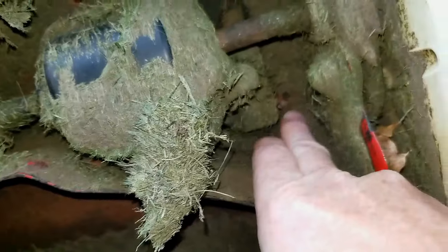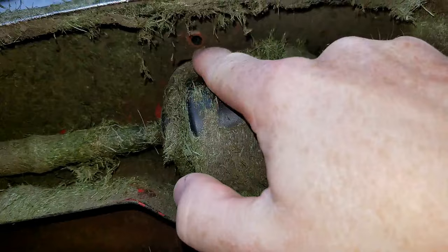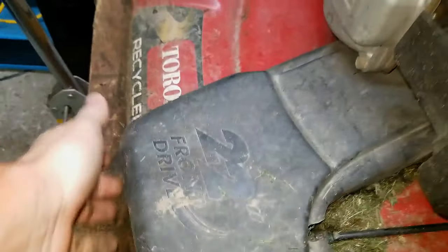I'm not sure we're going to be able to see that, especially with how dark it is here, so I think what we're going to have to do is take off the top cover to get a better look at the pulley on the front end on the transmission side. I've got the mower tilted up and there are two 10 millimeter bolts I've already removed — one back there and one right there — so the top cover should come off and expose the belt and pulley.